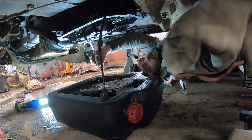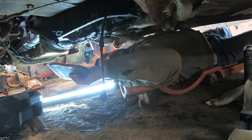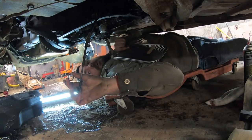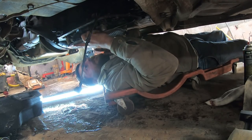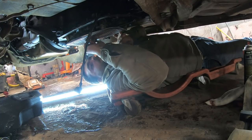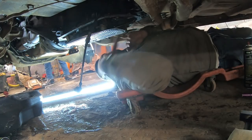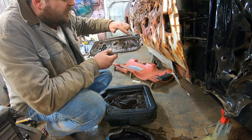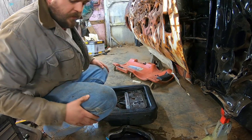I can tell you right now this has never been scraped on — that's never been off since it was new. These things are basically voodoo to me; I know enough to service them and that's about it. I could pull the valve body out and look but I don't really see any reason to. The filter just looks like this — that's pretty much wet dripping. There's just a little hole with an O-ring up here that you install the filter into. The bolt takes a special shoulder bolt that allows the filter to float inside the transmission pan — it's supposed to do that. When you tighten this down, it's not supposed to be tight; it's just supposed to float. Here are the exceptionally decomposed leaves in the old filter.